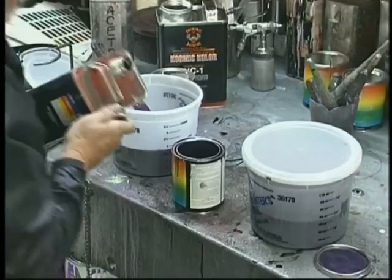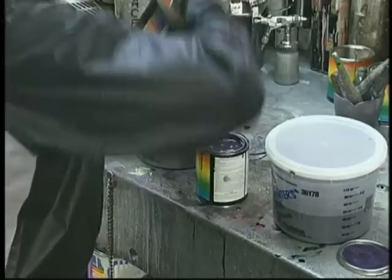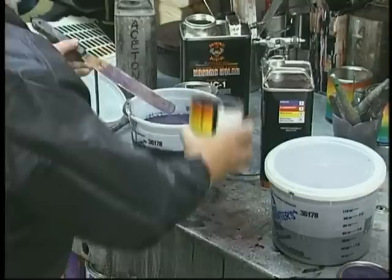We're going to replace the bag in the spray gun with a clean, fresh bag. We're going to blow thinner through the gun to make sure there's no left residue from the former black base, and we're going to strain into the gun cup. Now, these are not catalyzed. A TC23 is adequate for spraying this product.